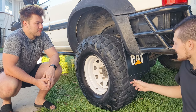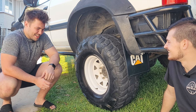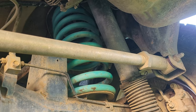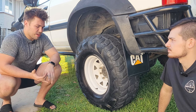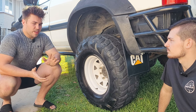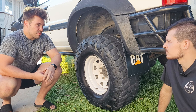At the rear Dylan lost his mud guards off-roading at Glasshouse, so there's a DIY mud flap solution to keep it legal for road use. The rear also runs the same 4-inch heavy-duty coils and 9-inch remote reservoir Dobinson shocks. Same 4.3 diff ratio as the front. It's got a tight LSD — no wheel spin at all.